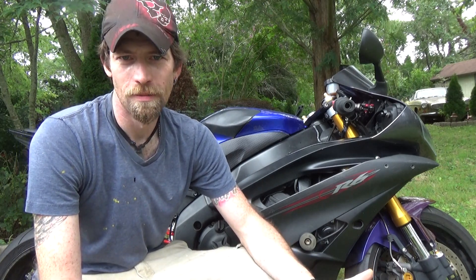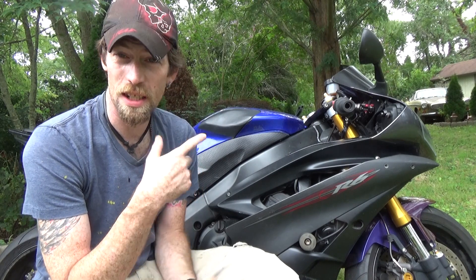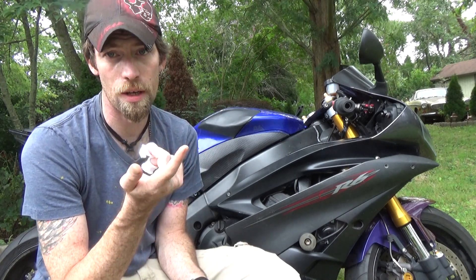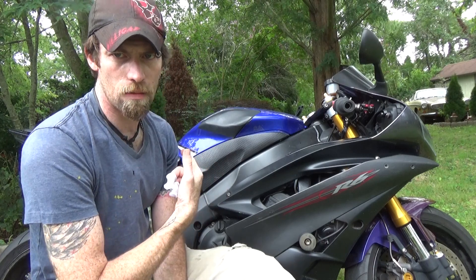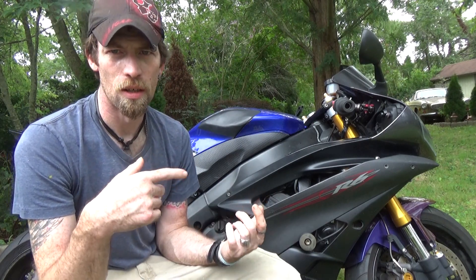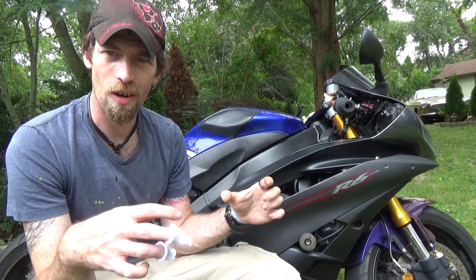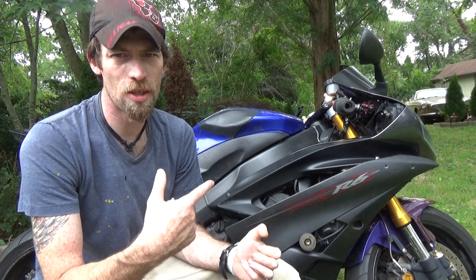Now it becomes the fun part. First, I've got to get it running correctly - I've got a couple of little performance mods to make it run better. This has the M4 exhaust - it's at least a mid pipe, cat delete, and muffler - but it's got the original ECU on it. I don't see any stickers saying it was flashed. Normally when somebody flashes a brain or ECU, they put a sticker on it - like if you get it from Boss Racing or Brock's, there's a big sticker on the case. No sticker on here, so I'll have to do something about that.